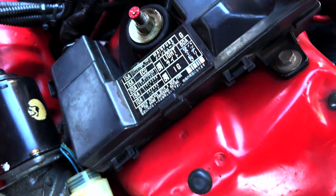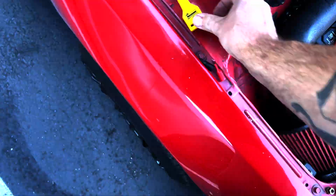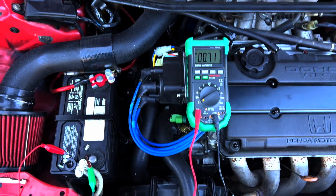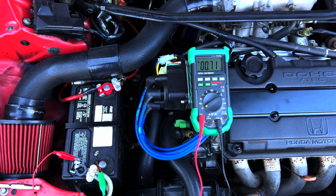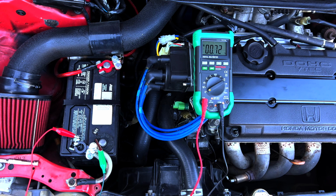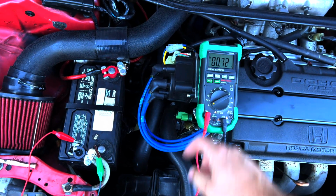That one happens to be stop horn. So stop lights, your brake lights, and your horn. But with this car, what's interesting, I've already disconnected the horn, checked out all the stop lights, checked out all the tail lights, disconnected them, tried to rule that out. Well, nothing happened. I still got the same value. Actually, it's going up a little bit, which is interesting.